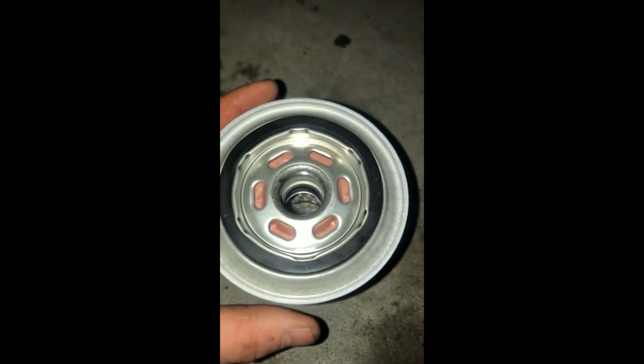It's the first place that oil goes right off the pump, to the oil filter. She'll only be without oil pressure for a second or two. If you only do this every oil change, it's not going to cause too much wear on your engine. Got a Honda Accord that I did this for every time, and it lasted 600,000 miles till the head gasket blew. So I'm not terribly worried about her not seeing oil pressure for a second. All the oil that's still in the cam journals, the rod bearings, everything else is going to protect her till she can build that pressure.